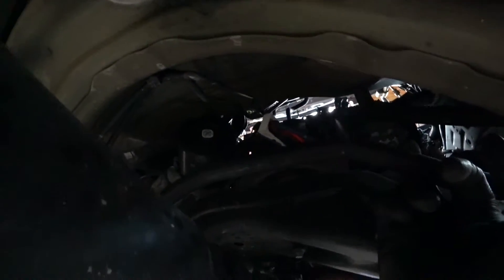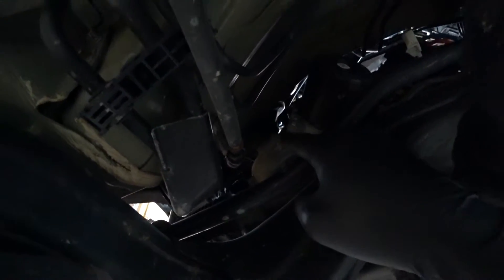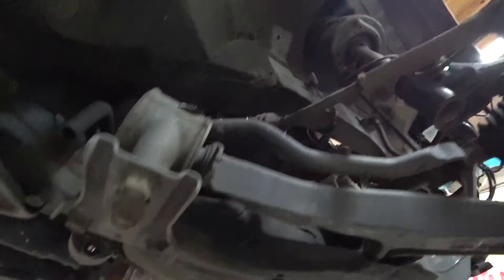I think I'm going to take the rack down with it, because the rack's electric so it's got this big plug here which I'm not sure how that disconnects — oh, like that. Push in that and then pull. And then we disconnect that. I should probably disconnect the battery before I do too much in that regard because those are some big power wires, though they shouldn't be powered. Then we'll actually have to go in the car and disconnect the rack from the steering wheel, and we'll disconnect the tie rod ends so we can take the whole steering rack down.